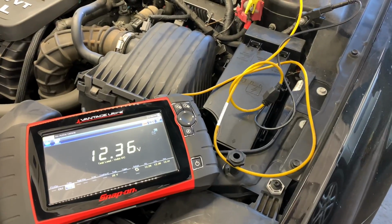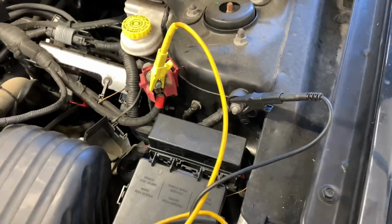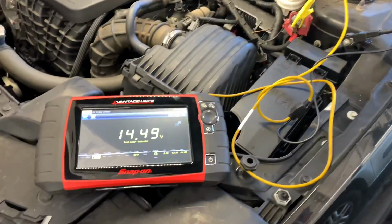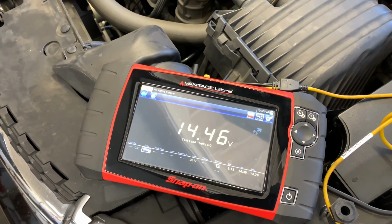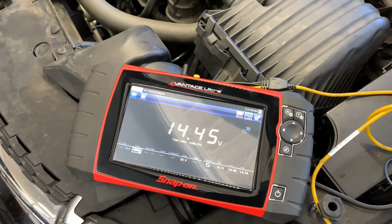So now I'm going to hook up a voltmeter to the positive lead right here on the fender well, and then the negative right here also on the fender well, and start the vehicle up and just make sure that my alternator is charging. I will link up the alternator and all the tools that I use in this video in the description.